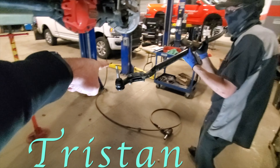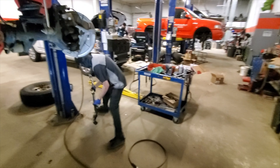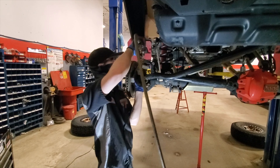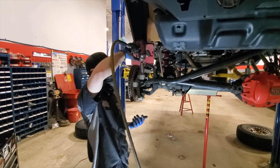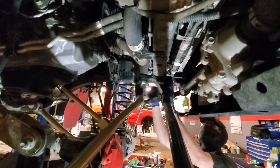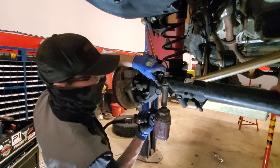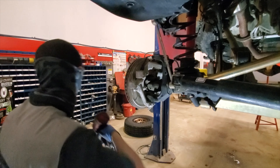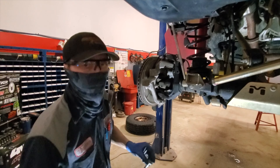For those watching — it's 21mm on the end, 19mm in the middle for that nut. Removing the drag link end at the knuckle, it's 21 on both ends — the top you'll need a ratchet wrench. Removing the aftermarket stabilizer bracket, it's 19 on both sides. We've got a new updated bracket so we won't be needing those bolts.